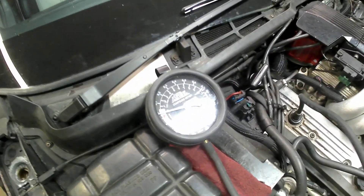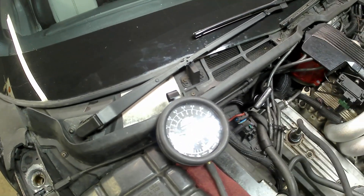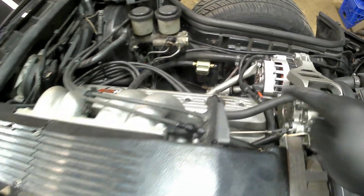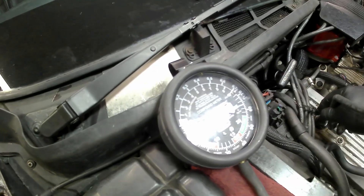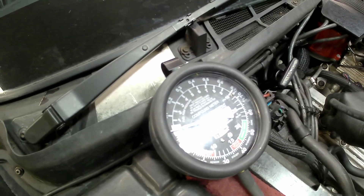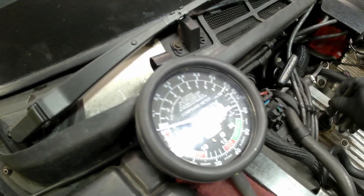I'm back, and I actually have a vacuum. What I did was replace the PCV valve underneath with a 90-degree hose, and at idle there's a slight vacuum. I don't know if you can see that or not.